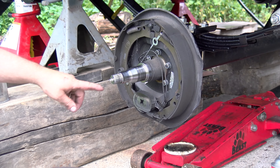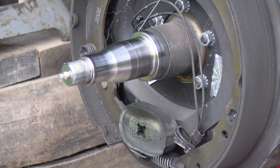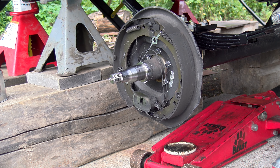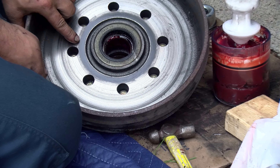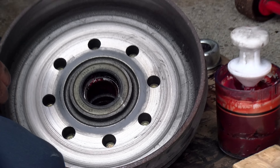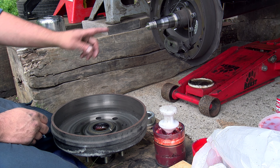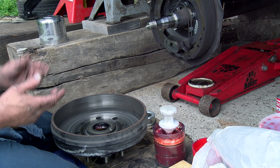Let's talk about over-greasing a little bit. This grease fitting right here is called a bearing buddy. Two to three pumps is all you want to put in, and you don't want to do it every trip. If you over-grease these brakes, by the time you see grease come out the front side — like most people like to see — you've already greased your brakes on the back side, and the brakes are not going to work properly. You can see in this drum, this right here is grease. The seal failed. There are no signs of over-greasing here — this thing just heated up and the seal failed, allowing grease to get to the magnet. You can see it on the magnet right here. That's a bad thing. When that happens, get yourself some brake cleaner, spray off the magnet, spray the drum, clean everything off really good. Then go ahead and repack your wheel bearings, replace your seal, and you're good to go.